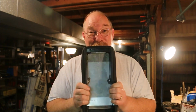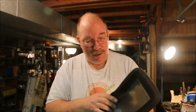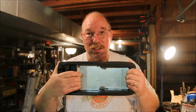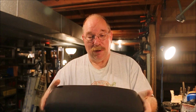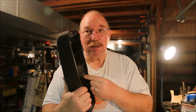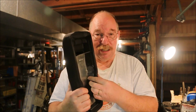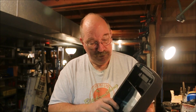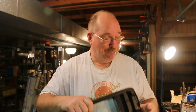That steel plate, that's plenty solid. And putting the JB Weld in there, that's going to bond it to that plastic really, really well. Make this whole thing self-supporting, so it's not relying on just 4 little rivets to hold it together. Because I was concerned that this whole thing was just going to come apart under side load and things. Because this one was actually cracked. I had to repair that little section right there because it's cracked up the side. But now it's going to hold up.